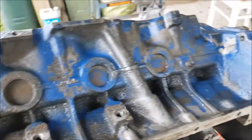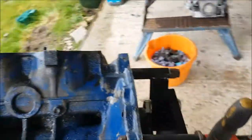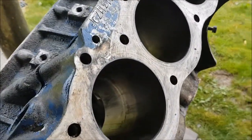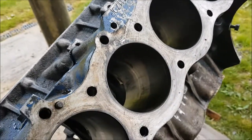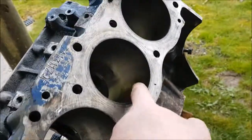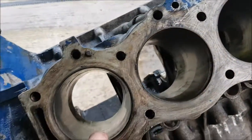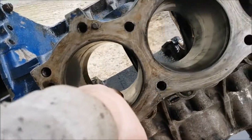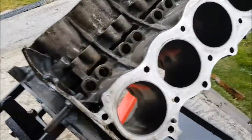I've given it a right proper gunking off. It's not horrific - it could be a lot worse. A couple of things I've noticed: first and foremost, I don't know if you can see, there's a tide mark in this cylinder. Yeah, that cylinder was full of water and left. It's not badly rusted but it certainly needs a hone. There is no lip at the top of any of these bores, and I'm going to double-check the size. There's a nasty mark on that cylinder down there - hone might just get that out.